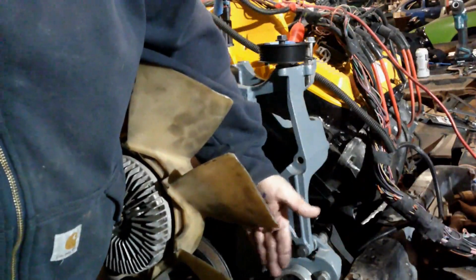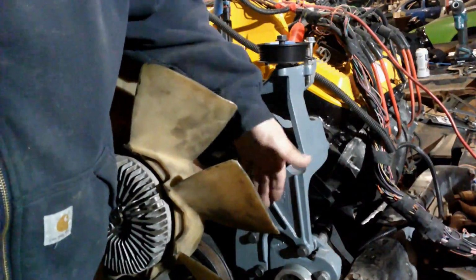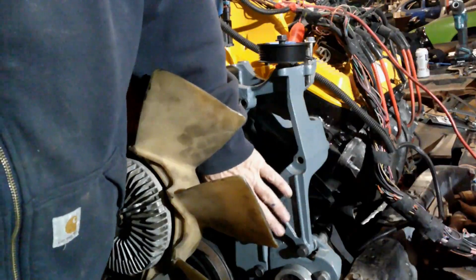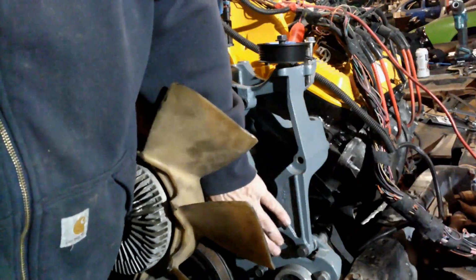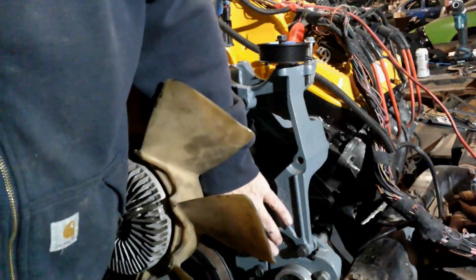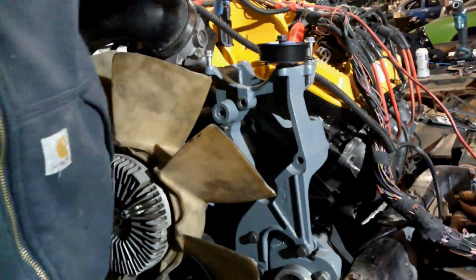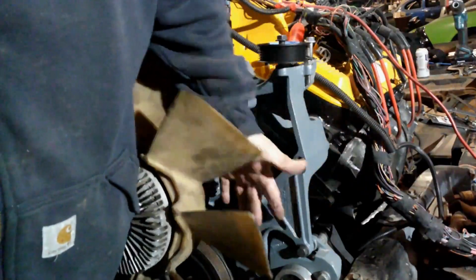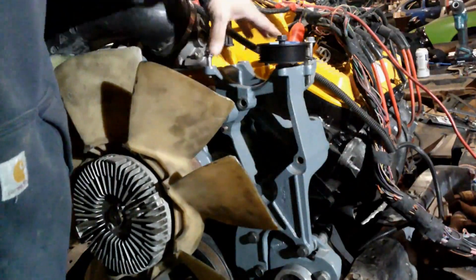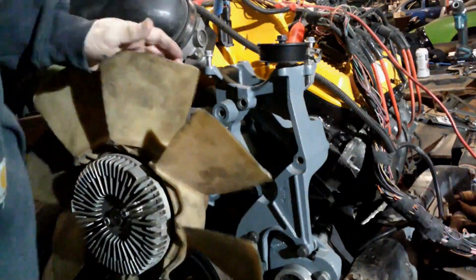we're gonna move this power steering pump closer to the crank, away from the frame rail. It might go up just a little bit as well, because we seem to have some room to play there. In fact, what I'm going to probably wind up doing is scrapping this ZF pump and going to a Saginaw pump, because I have a Saginaw pump already on my motor, and I'd rather just be able to buy factory parts that fit my truck with that Saginaw pump and just bolt that Saginaw pump to my new bracket and still be able to bolt on an AC compressor eventually. Yeah, it looks like we're gonna do a send cut send project, guys.